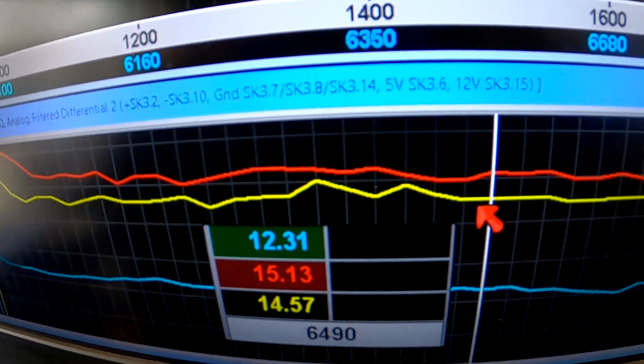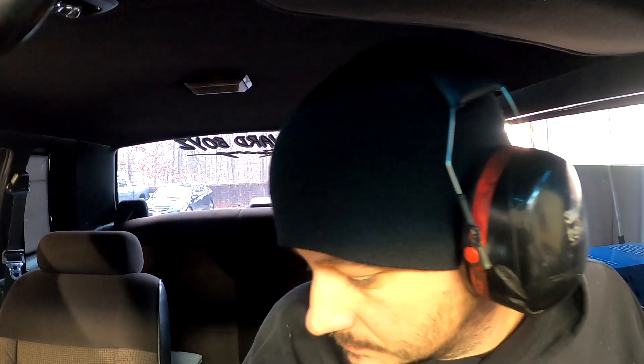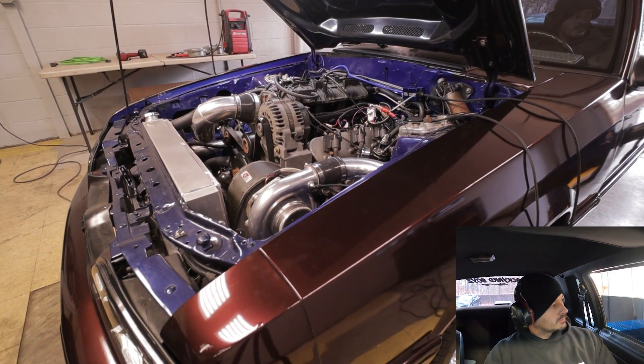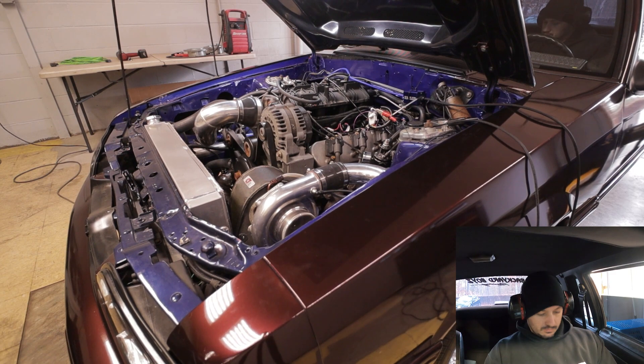Probably even more interesting is we've made more power with less boost too. Hopefully this is the last one we'll have to do at this boost level before we can start throwing some CO2 at it. 709 - yeah, we're definitely done on timing. Let's throw some CO2 at it. Boost keeps going down with timing, so it's actually only like 13.0-13.1 PSI, not even half a pound higher than what we were on pump gas.